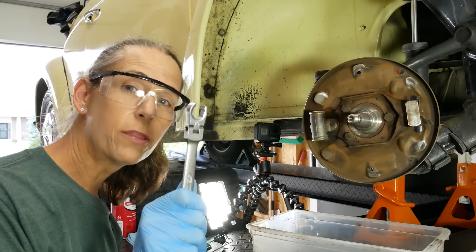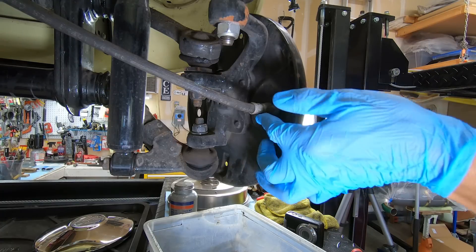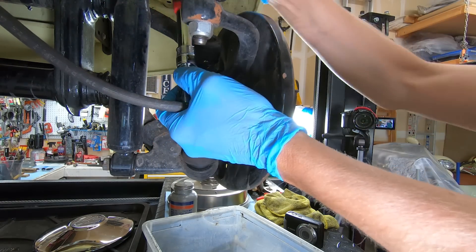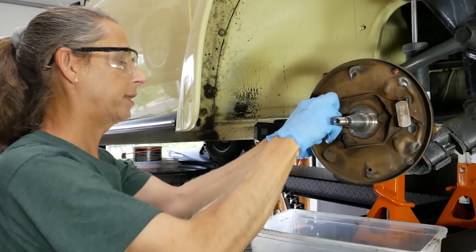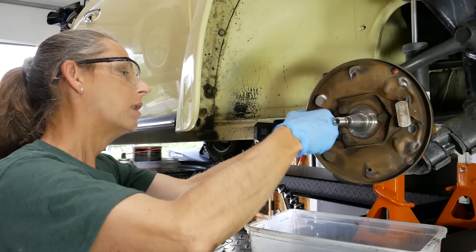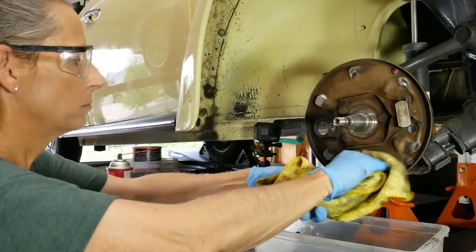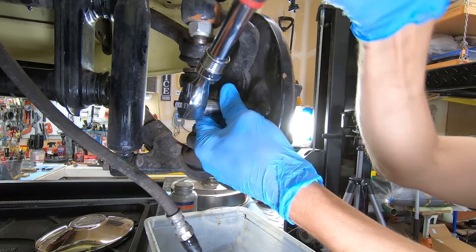I'd love to use a flare nut wrench on this fitting, which is the correct tool, but the brake bleeder is right next to it and I just can't get the wrench in there. I'll loosen up our brake cylinder first — just a 13 millimeter bolt, nothing special. I can unscrew the line this way, which makes life a lot easier. We're going to lose a little brake fluid so I've got a rubber plug ready. Now we can install the new wheel cylinder — it just goes through here and we reattach our bolt on the other side.